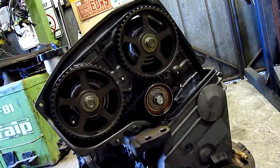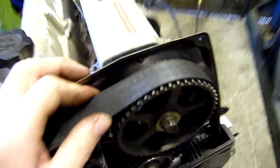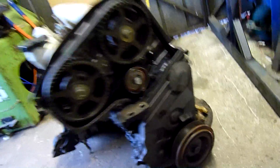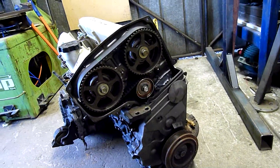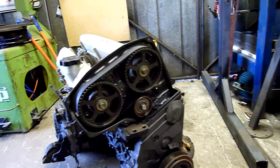That's moving — I'll get that out again, but it's going to take a bit of oomph to get that harmonic balancer bolt out. Oh well — it's got a new timing belt, or near new. I can still see the printing on it. The timing belt's nice, and it looks like the whole kit's been done — the water pump's been done, the housing's been done. The water pump's probably dried out and the seal's probably dried out, so I would never use that again, but the housing itself is well worth keeping in stock.